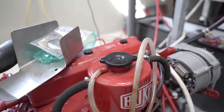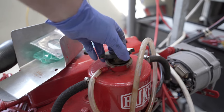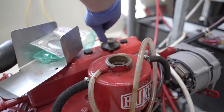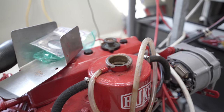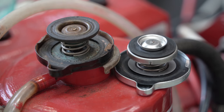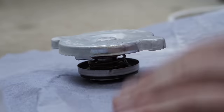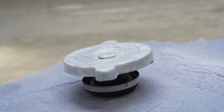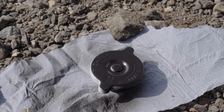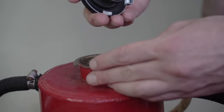This has been bugging me for months, and the turbo job reminded me to get it done — the pressure cap on the coolant expansion tank. It's corroded in and out, and looking a little sad after 15 years' service. I don't want it to fall into pieces and shed parts into the coolant stream. Here's a new one. It's not an exact match, but fits and is set to 7 psi, which is within the correct range for this system. Do I need to paint it? Maybe not, but it's just chrome plated and all the other engine accents are black, so we'll go with black. First a sanding to scuff the surface, then a good primer, and finally a coat of glossy black. A quick and easy job, but another one ticked off the still rather alarmingly long list.